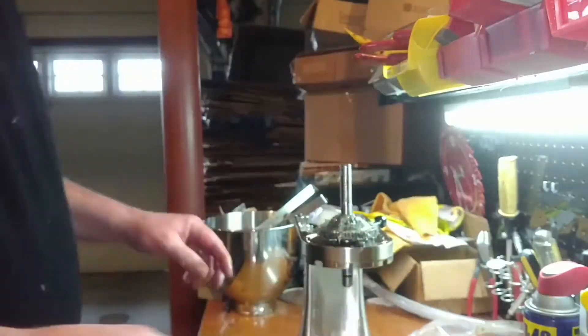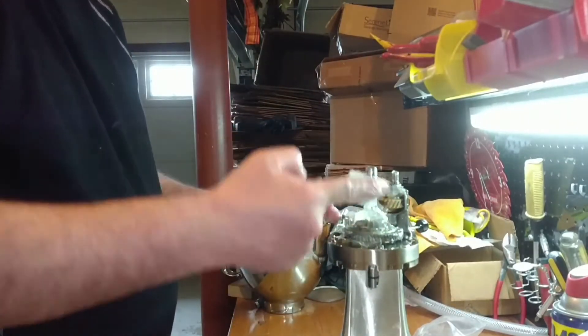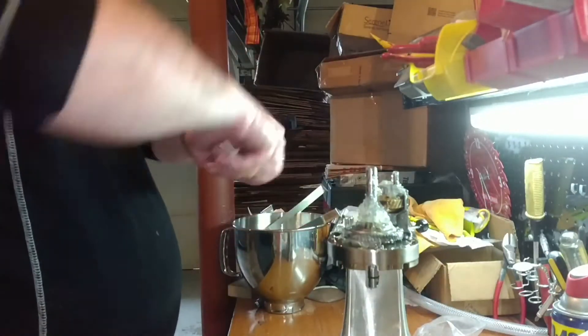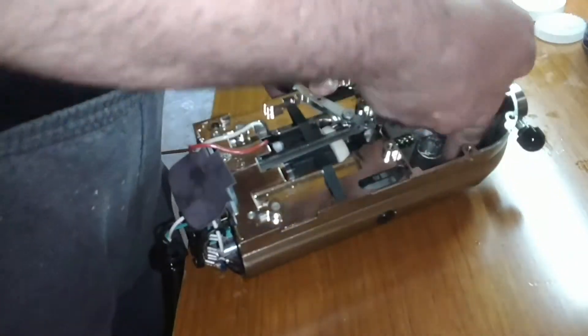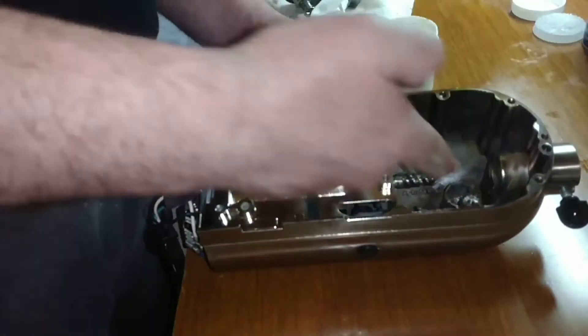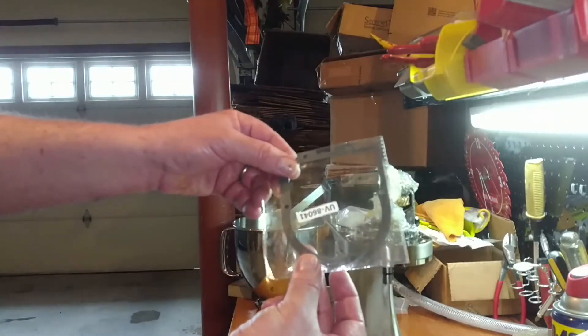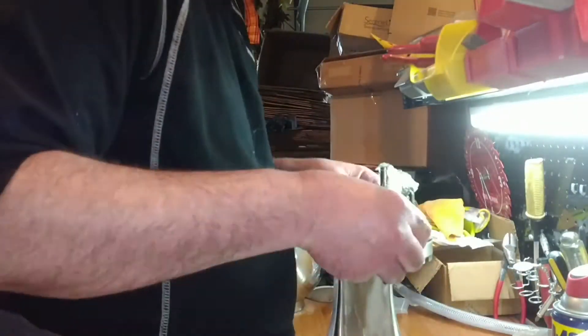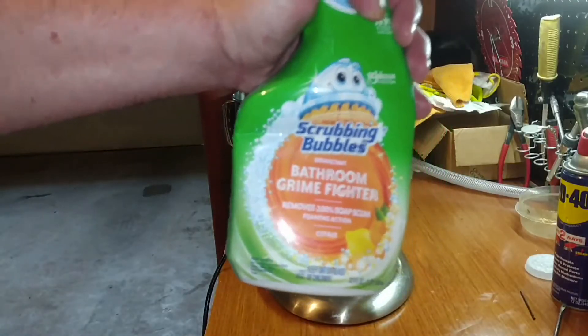Put back the little gasket and put the rest of the gears back in place. Make sure everything's nice and tight, and use all the grease in the tub — four ounces is about what this machine requires. Pack that in tight. Don't forget to pack your gears and bearings on the top assembly where the motor is, and make sure that worm gear has got plenty of lube on it. I'm putting in a new gasket; the old one looked okay but I went ahead and replaced it. Once you've got that, you can put it all back together and clean it up.